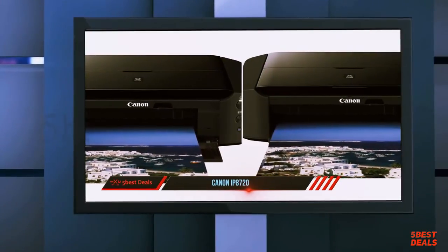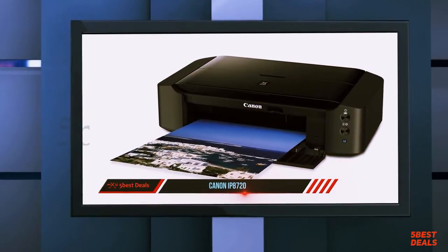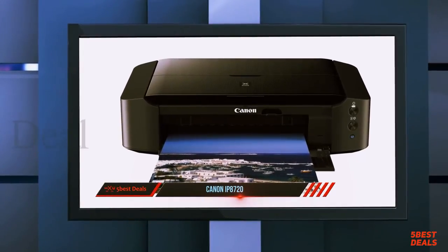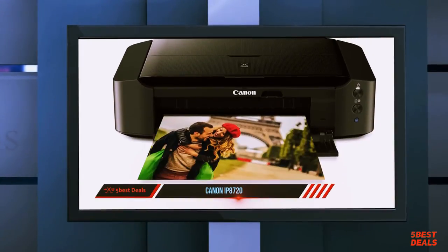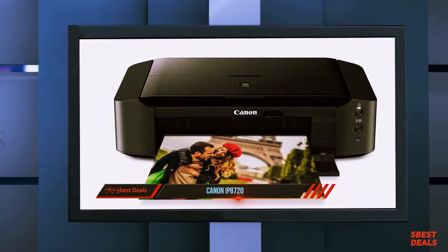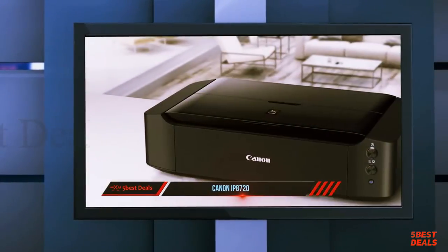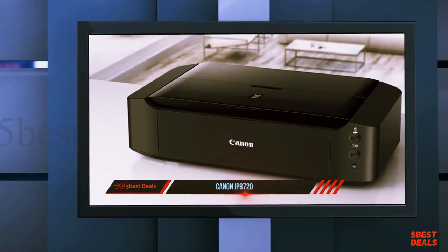Once installed, you will see a light on the front of the ink tank illuminate and glow steady red. The same light blinks slowly when you're low on ink and quickly once the tank has been depleted. The rear tray can hold up to 50 sheets depending on the thickness of your paper. Photo papers like luster, satin, and glossy at 10.4 mil are expertly handled by the iP8720 with no misfeeds. If you're using matte paper or thick media, fewer sheets should be fed in at one time, and fine art stock, canvas, and specialty paper should be fed one sheet at a time.